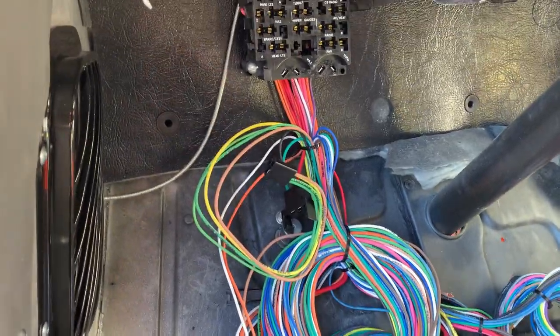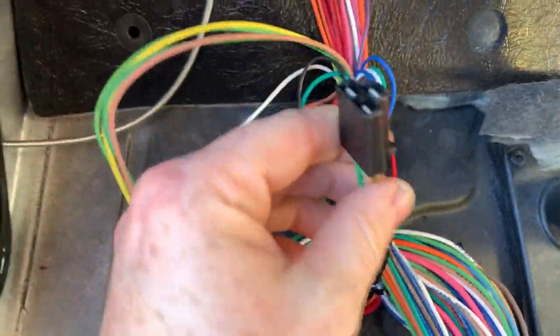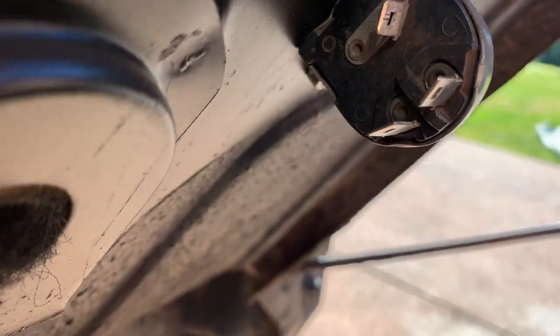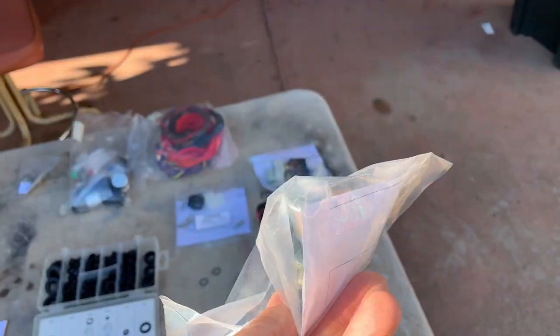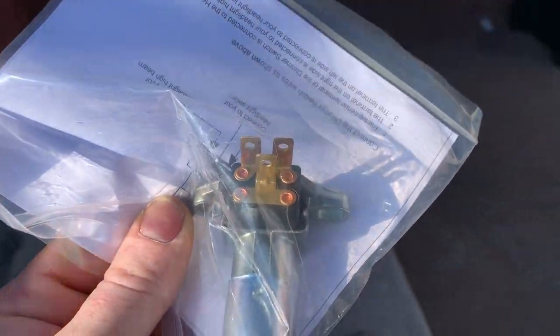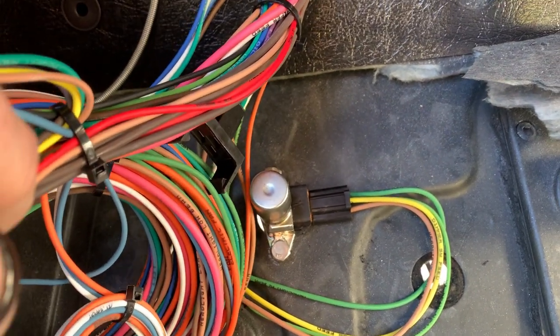What I like to do first is go in order with the shortest wires. This is for the dimmer switch — it plugs into that button you hit with your foot, old school setup for high beam/low beam. However, if you look at the connector for that, it's a three-prong connector, but not the same configuration as what we have. Luckily, inside this kit they supply you with a new switch with the connector that'll match. New switch installed and wired. Let's keep on going down the line.